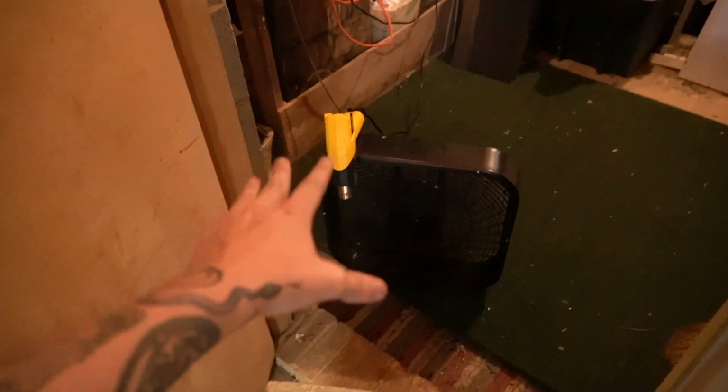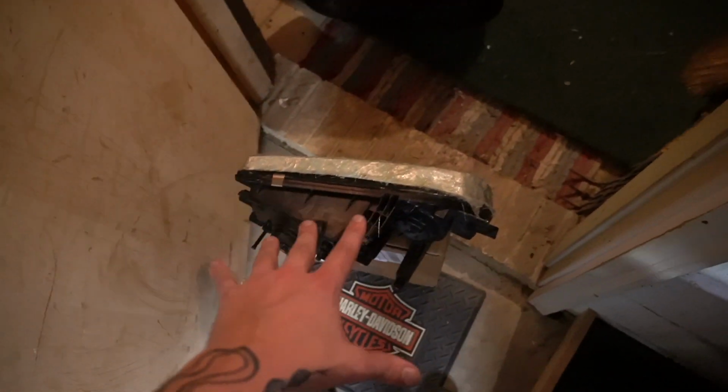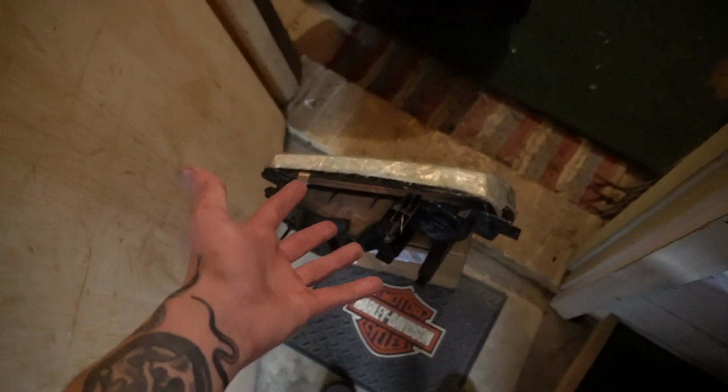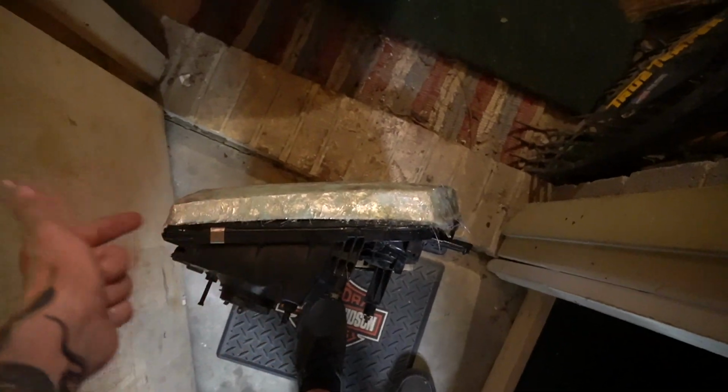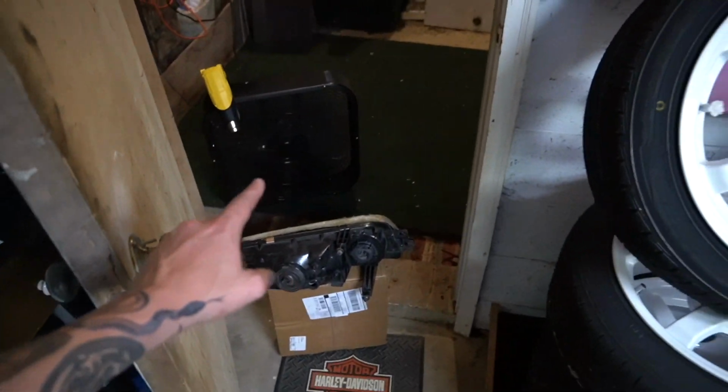We have the fan and the heat gun blowing some warm air on this. My next step, I believe, is if this doesn't cure in another hour or two, to remix some resin, make sure it's really mixed, do another layer of fiberglass, and then wait to see what we get. But that's your little update. See y'all in a little bit.